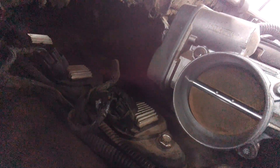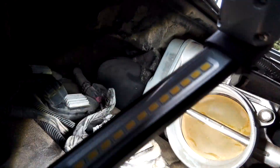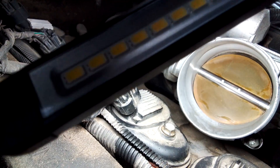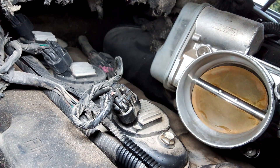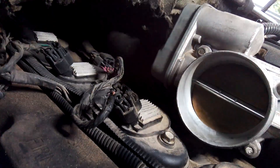Now, uncleaned and untouched by human hands — I'm going to show you my throttle body and show you how dirty it is not. I've got maybe 20,000 miles on this. Nothing. It's clean. That has not been cleaned. No gunk anywhere. So the story is, if you've got gunk, you've got a crankcase ventilation problem. And a crankcase ventilation problem is because you're not purging the crankcase.